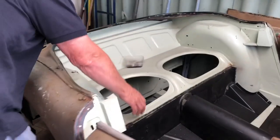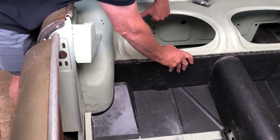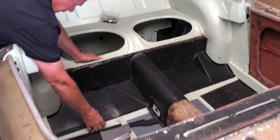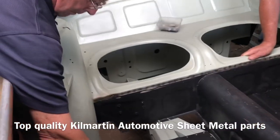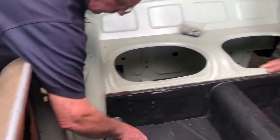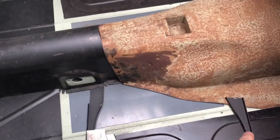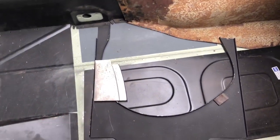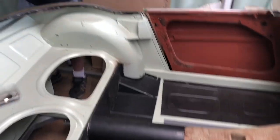I took this back section off. And I think when I put those in, it's just going to go forward a little bit and clear there. These are from Kilmartin, are they? So I popped that one in — you'll see I've got these with the... it goes around here quite nicely. You had to do a little bit of tweaking but nothing significant. So they're punched now, ready for plug welding. That piece there goes inside the firewall. On the early B and 4s they didn't have that, but speaking to Greg, he suggested I should because I get a bit of firewall shake. So that just helps to lock them in a bit better, give it a bit more support.